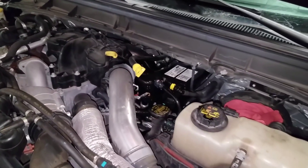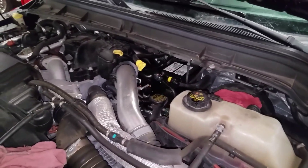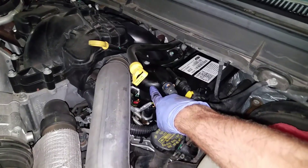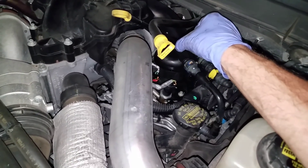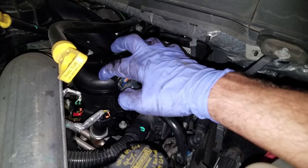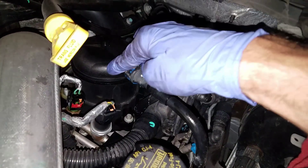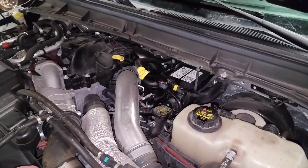Alright friends and guests and returned viewers, that is how you replace a secondary fuel filter on Ford's awesome 6.7 Power Stroke. 2011 through pretty much current model is the exact same way. The 2017s and 2018s have a third port right here — it's actually probably easier to pull off than these two lines because it's a little square clip that comes off and just a real soft line to squeeze. That hose over there on the 2017 and 2018 is the return line for the fuel injector, so instead of piggyback routing this line, it now goes to a third port — just a little something they changed between body designs and model years.